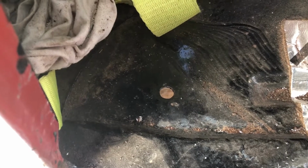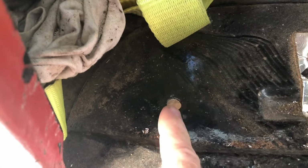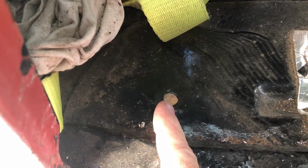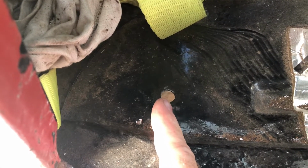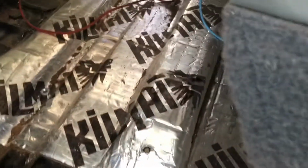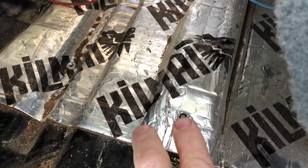Okay, the next thing that you're going to worry about is mounting the retractor. Again, I had already installed seat belts in this at one point. They were just too short, and so I had this hole made for my mounting plate for the retractor, and that's what I'm going to use again. It was the same location on both sides of the truck. No point in drilling new holes in my floor, so that'll be easy. The retractor will go here. It'll feed up through the anchor and then come back down to this hole that I've started right here for the other side of the main belt.